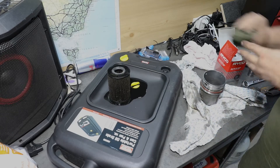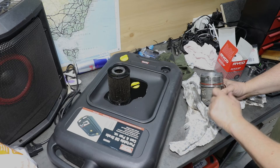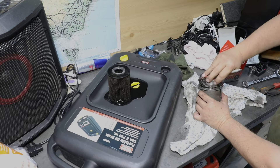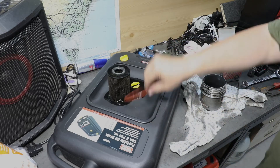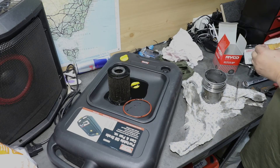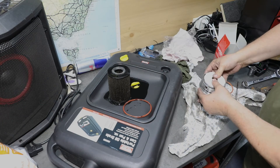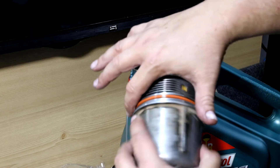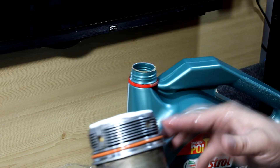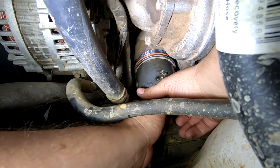Give it a tidy up, a wipe out. Once that's all cleaned up and ready to go, one of the things I'm going to do is remove this seal. When you get your Ryco filter, it'll come with a new seal — very important to replace that. It compresses over time, and if you reuse it there's a good chance you're going to end up with an oil leak, so don't risk it. Get rid of that and get a new one on there. New filter looking a whole lot better than the old one. When you pop the filter in, in this case it's going to be a very reassuring click so you know that it's in there. And just like any other filter, make sure you lube that seal up with the fluid you're going to be replacing — in this case, the new oil. The filter's on, the seal's on, time to screw him back home.